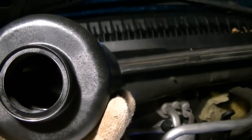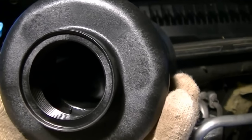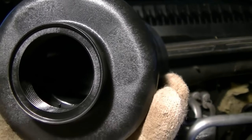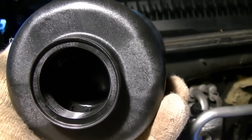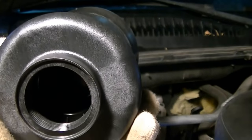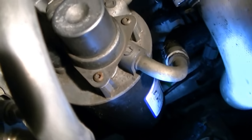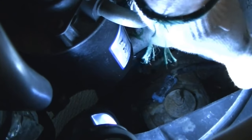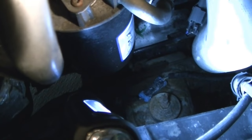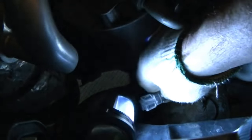On the bottom here is where your water drain is, and there's also a sensor down there with a wire that comes off of it. That's your sensor to detect if you've got any water in your filter. It's a little bit hard to get into here with the camera. There's your filter — you'll see a wire running off the bottom of it. There's a little connector there and you'll have to disconnect it so that you can unscrew the filter.